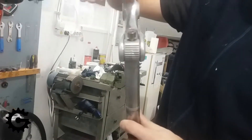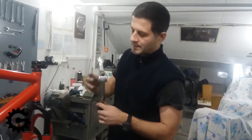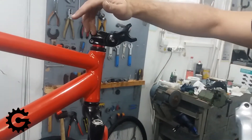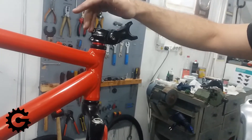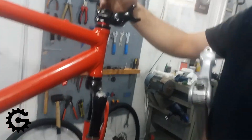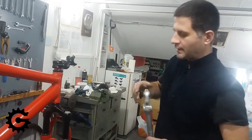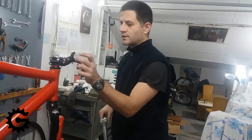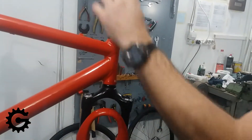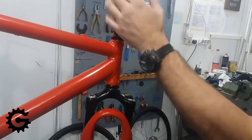This stem has two pinch bolts. There are models that have only one pinch bolt and I would not recommend using such stems even if they are a few grams lighter — I think it is not worth the risk because having steering control is crucial for bicycle safety. I would say even more than wearing a helmet; you need to be in control along with good working brakes.